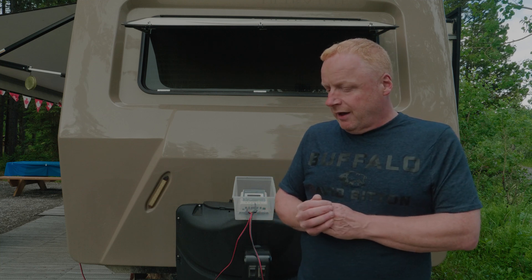This season we started with two 6-volt batteries that I accidentally left in the trailer last winter. Within a few days of dry camping this year, I realized they weren't holding charge like last year. After doing the math I found the batteries were at about 70–75% efficiency. If you can only discharge to 50% on a 75%-efficient battery, it doesn't leave you much usable power, so I replaced them right away.